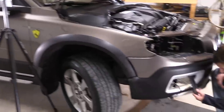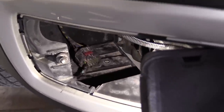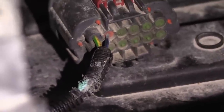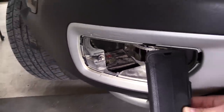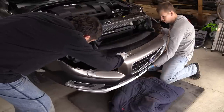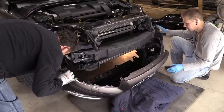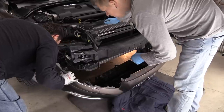While working on the passenger side we noticed — looking into the passenger side fog light area — a pretty extensive connector with corrosion at the wiring. No wonder my headlight washers are not working; there's most likely more damage on the wiring in the bumper cover, and this connector will need to be disconnected when we pull off the bumper cover. We suspect that mice did this damage. The next step is a two-person job: both of us are going to wiggle the bumper cover off toward the front of the car. I don't have parking sensors or adaptive cruise control, but I do have headlight washers — which haven't been working for over a year.